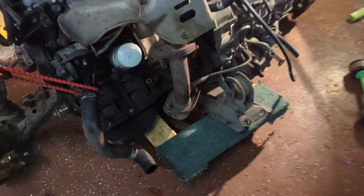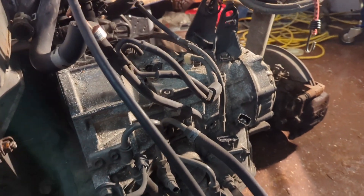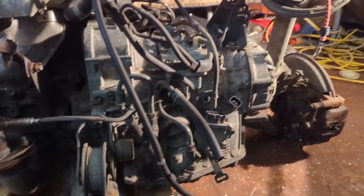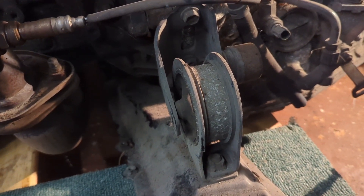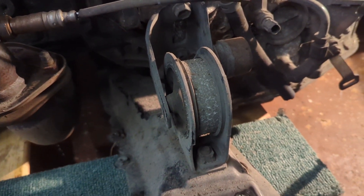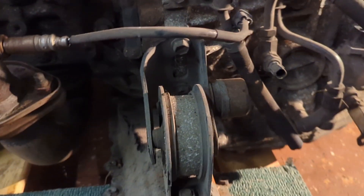First things first, you're gonna want to undo your front motor mount. It's actually on the transmission, and mine is an automatic so it's gonna look like this with all those wires and trans cooler lines hanging around. There's one bolt that comes right here and it's got a nut on the end of it — both are 17 millimeter, so get a wrench and your favorite impact and go to town. Mine despite having near a quarter million miles on it was not that tight, so I only had to do one small burst of the Milwaukee quarter inch impact driver.